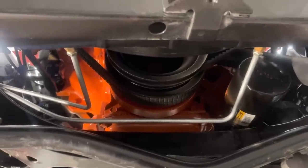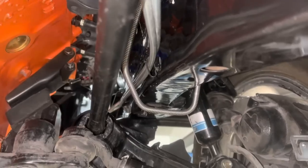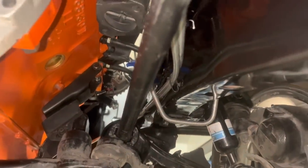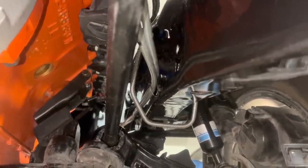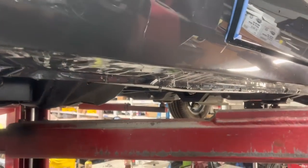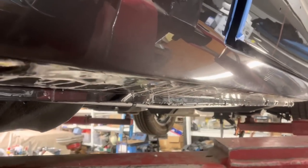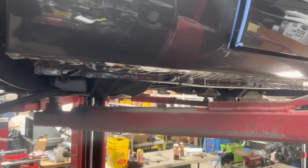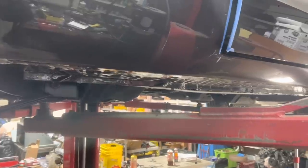Source of oil leak confirmed. Why is there a hole punched in the filter? Just need to secure it up there and I call that good to go. Instead of fabricating some fancy bracket, I decided to keep it simple stupid and use a factory-style line clip in a perfectly lined hole. I also added one to the fuel lines as well as a couple of the S-clips that keep the two lines together. That looks a lot nicer. One small annoyance: because there are two lines here and the bottom one is huge, it doesn't really tuck up under the body and you can see it next to the car from certain angles. Either I need to bend those up in there better or come up with some other clever solution.